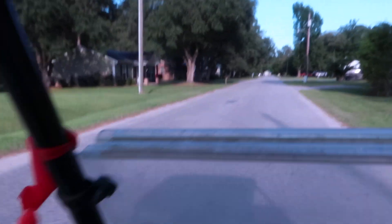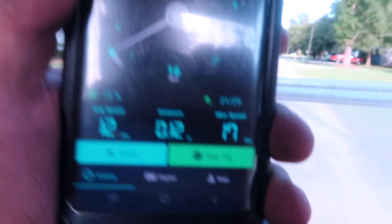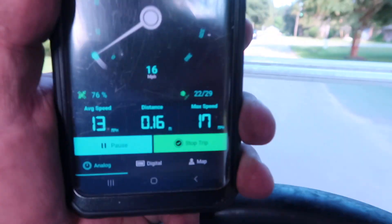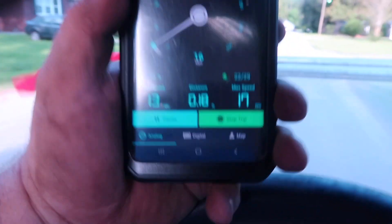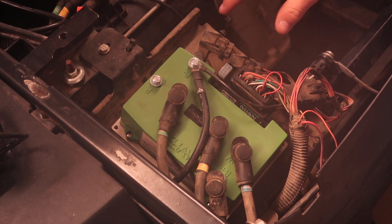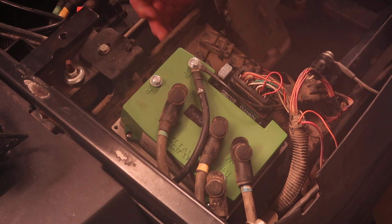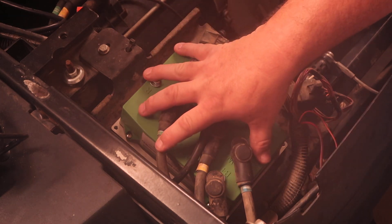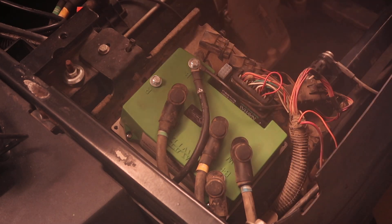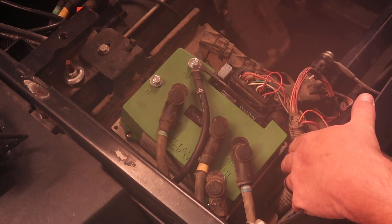So we're doing 12 miles per hour. That max speed is not great — we're not doing very much. This is a 72-volt lithium on the Cushman, so I think we need to go ahead and throw the Navitas controller on here and see what kind of speed we can get out of it. I went ahead and put the Navitas controller onto the golf cart. I've got one bolt going through the mount of the golf cart into the controller, however the controller is a little bit smaller in its shape and mounting pattern than the stock Curtis was. I'm going to take a punch, punch the rest of the three holes, drill those, and put the bolts in place.